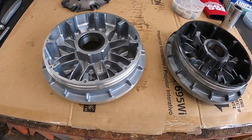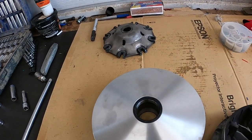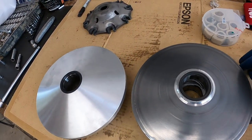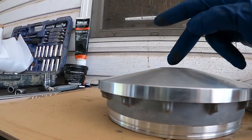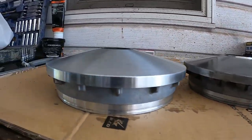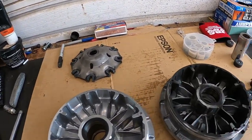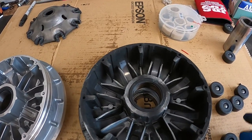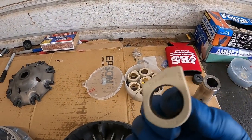Now the biggest difference between the Hunterworks and JBS — the obvious difference — is hard to tell from looking at it machine-wise. The Hunterworks leaves a lip here where the JBS shaves that clear down. Other than that, it is really hard to see any difference in the sheave. Internally is where you get the biggest difference. Hunterworks prefers to run the greaseless, using standard typical weights, whereas JBS runs overdrive weights. So a little bit of difference in design and function.